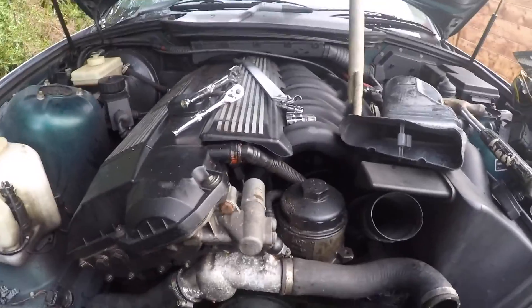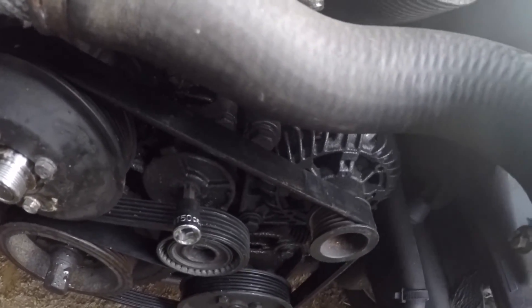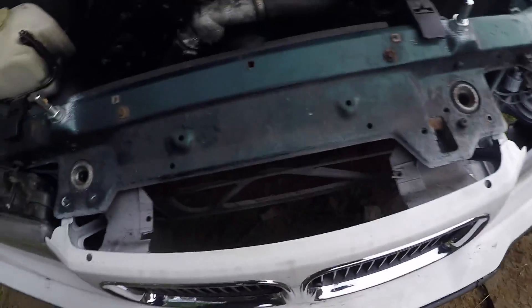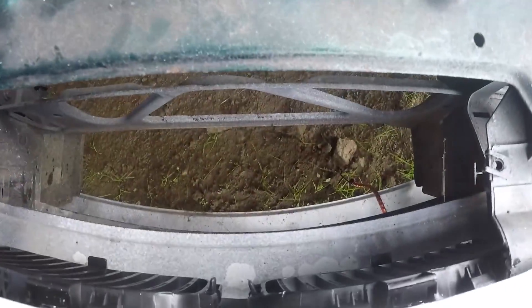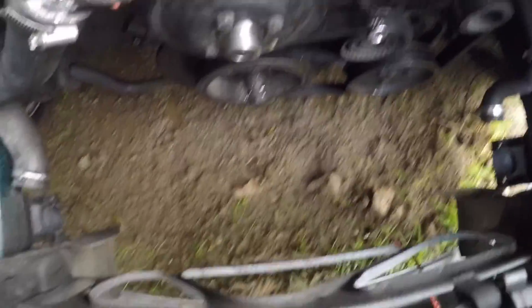Just put the pulley back on. That's the pulley — and that's about on. It's actually quite easy; there aren't that many ways it can go on. You just have to remember to loop it around the tensioner. Because I had so many issues with the tensioner socket, I did take the radiator off — it just meant I could get a hammer in there. It does make your life a little bit easier, and these radiators are so easy to take out.